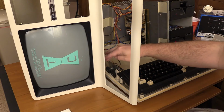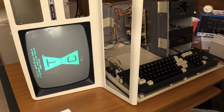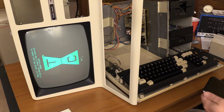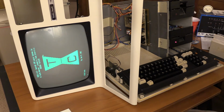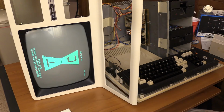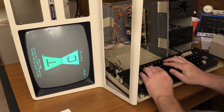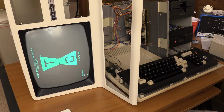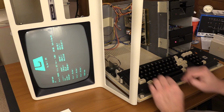Oh, hello. Hello. That's a good sign. What the hell's today's date? I was going to pick a year, but 09, 17, I'm going to call it 83. You can see it says 93 on there, and that's because I patched it before I got TRSDOS 6.0, so you could type in 83 and it would replace it with all 9s. And I rearranged the dates. I just used debug and edited the file. I did this back when I was a teenager, just because. So let's see how the machine works. Drive's nice and quiet, actually. Kind of surprised.